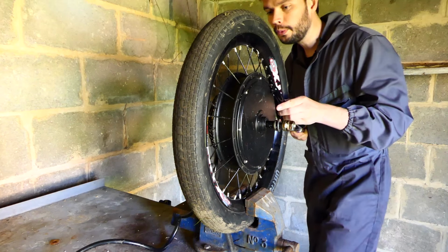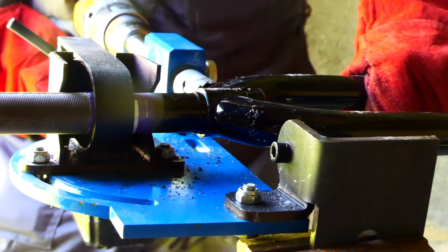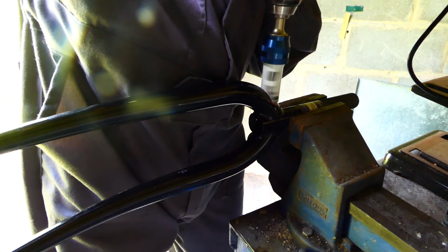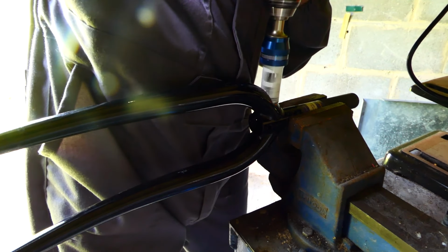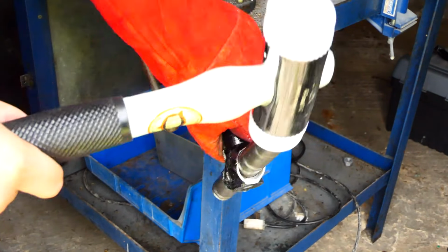The mini electric Penny-Farthings were so much fun, I thought I'd apply the same principle to my big one. I plan to use my 3 kW hub motor from my drift trike. With 72 volts, it'd be good for about 40 miles an hour. The rear wheel on the Penny-Farthing is mounted using front forks off a normal bike, so I bought a spare set. The hub motor is made for a rear wheel, so they have to be made to be wider.